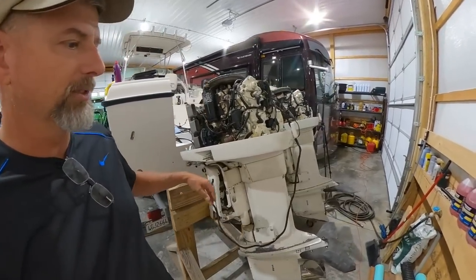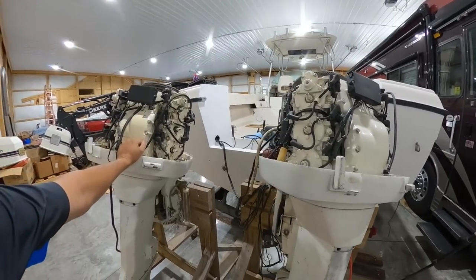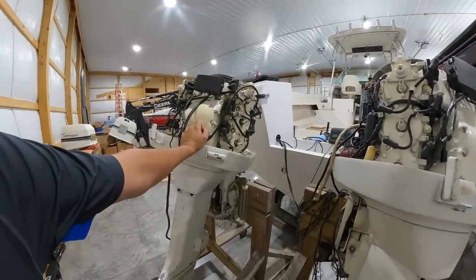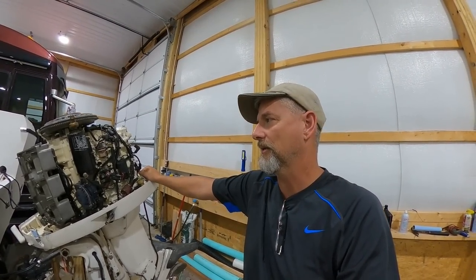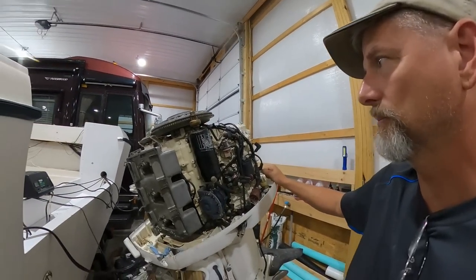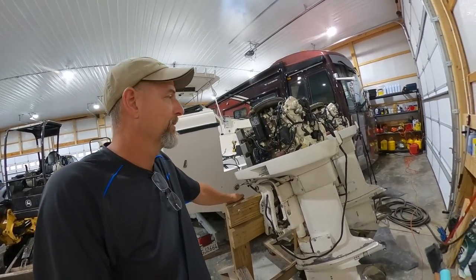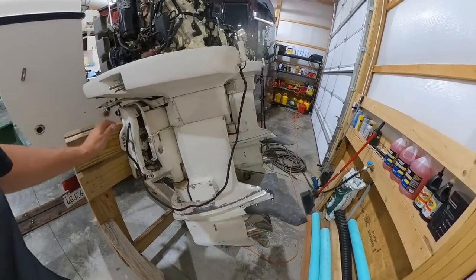I'm probably gonna just get a solenoid for this side — that non-start issue, I'm not sure, it could be the starter on this side too. Whatever it was, it didn't do it again. The good thing is I'm on a lake, not the ocean, so if it doesn't start I have the other engine to get me home. All right, we got to figure out that one cylinder and why it's low — we matched up 70s all across the board except for that one. The next day, I'm thinking I'm going to try running them. I know 70 is incredibly low, and I have that one that's even lower, but I believe these are low compression. At 70 they'll all run the same — it just won't have a lot of power compared to what it used to have.